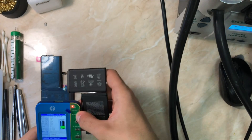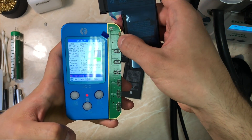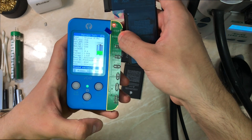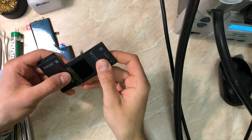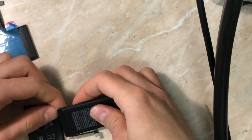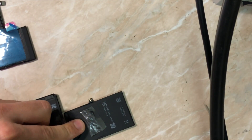Let's begin by unwrapping the battery connector. I'm reading both the original and the new battery just to test that everything is okay. This is very delicate work, so be patient and careful. I'll try my best to show every little detail without making the video too long. We'll begin by unwrapping the original battery so I can disconnect the battery port and then solder it to the new battery. The main focus will be on the original BMS board.